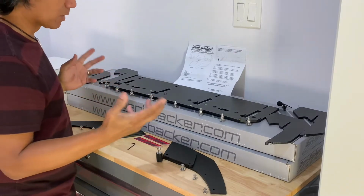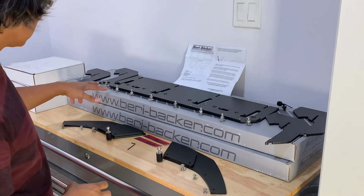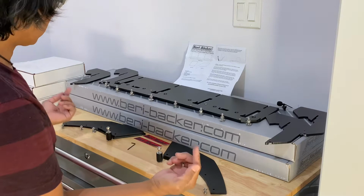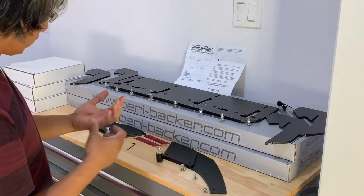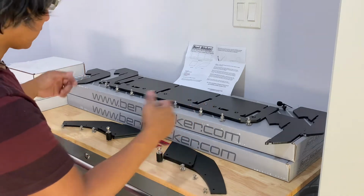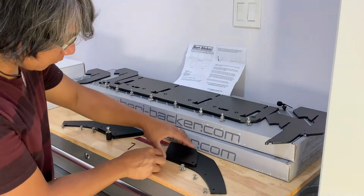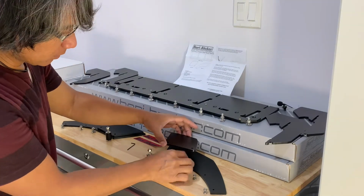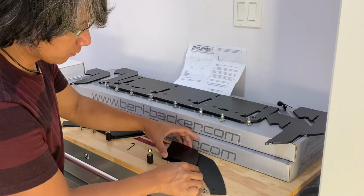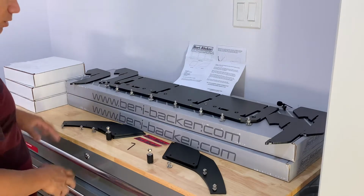Based on our instructions, this is basically how you can install this diffuser. I want to lay out all my hardware. These 8 bolts right here are going to sit on each one of these holes, tapping into a drilled hole in the rear diffuser. As well for the side spats for the diffuser, this tall one with the extension will sit right in here, and this bolt will be bolted onto the rear diffuser again with a hole drilled through it, and those two will sit right there on the rear diffuser. Similarly on the right side or the left side as well.